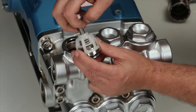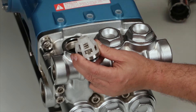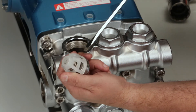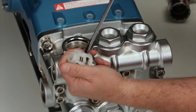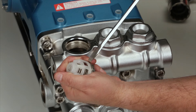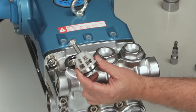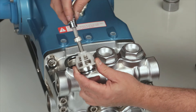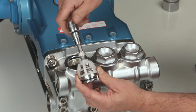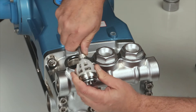If you're servicing the valve assembly, begin by separating the spring retainer. There are two methods that can be used to separate the spring retainer from the valve seat. The first method is to insert a flat tip screwdriver through the spring retainer just above the valve and turn the screwdriver to create a small gap between the spring retainer and valve seat. The second method is to use a 10 millimeter bolt and thread through the spring retainer. As you tighten through the spring retainer, it will make contact with the valve and then create separation.